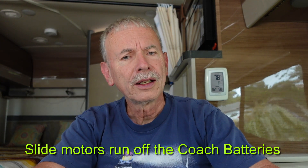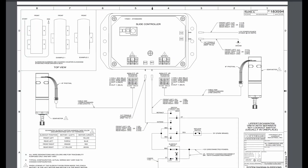These slides are fairly reliable and not likely to have a problem. In my case, it was just a bad connection between the motor and the wiring. If you do have trouble with the slide on the road, first thing to check is make sure your brake is on and the engine is running — those bypasses are important. As long as you have good voltage in your batteries, it should work fine. If it doesn't, take a look at the controller. It has flashing lights to give you an indication of where the problem is — it's a little tight under there, so I recommend using a mirror. Controllers seem to be pretty reliable. The motors you'd have to replace, and if you're not very handy, it's just too much messing around — just call somebody. But now I have a spare motor in case there is a problem.